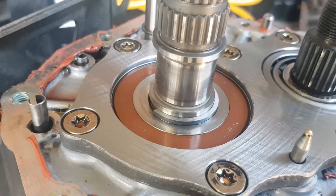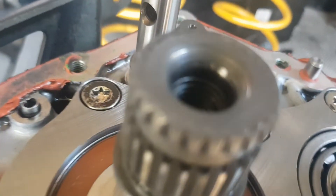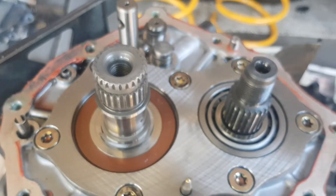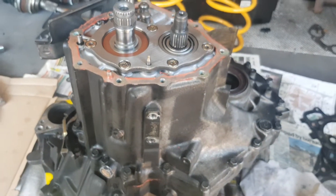The next part I'm taking to get apart this gearbox is to get off these little C-clips here. These are the gear selector rods. We're going to take the C-clips off there too, and then we're going to take this plate off. That's going to allow us to get the actual housing split in half.